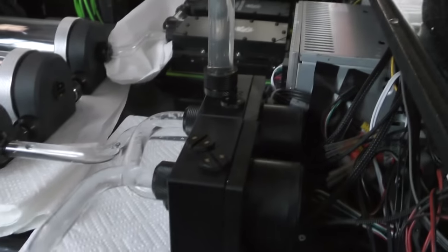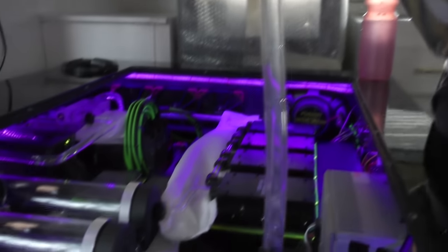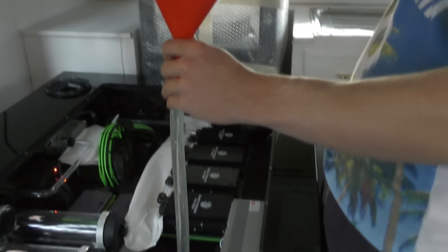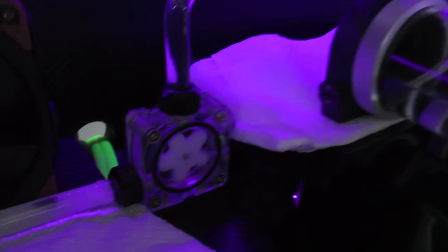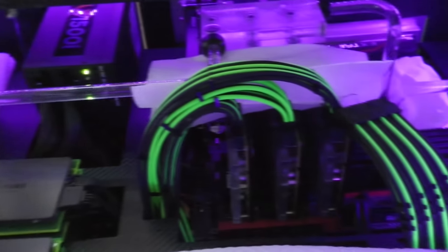Here's how I fill the desk PC. I add a tube and funnel to the inlet of one of my pumps and let the water suck down by gravity. I wait for everything to fill up, and once the reservoirs stop gaining in levels, I undo one of the fill ports behind them to let a bit of pressure out so the levels can rise. I like them about half filled because I like seeing the liquid moving.